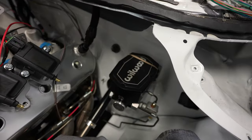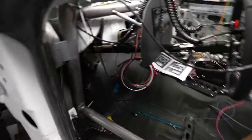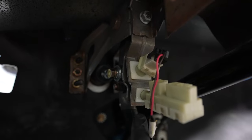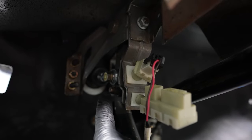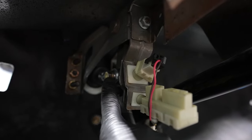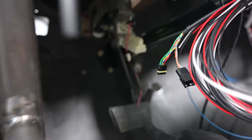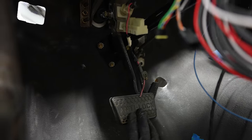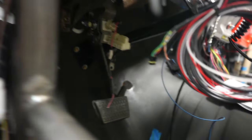After a couple minutes, I got the master cylinder fully mounted. I ended up getting it mounted in here using a heim joint like what comes off the back of the Wilwood. I got a shorter stud that comes out of the back of it, put a bolt in here, and welded a nut on the back side of the factory pedal. So now we've got pretty much all we need right there for travel.